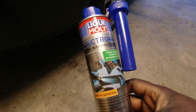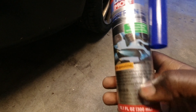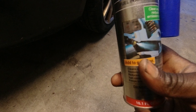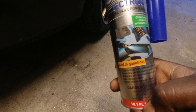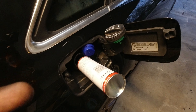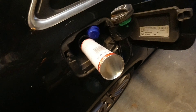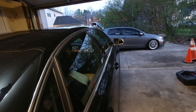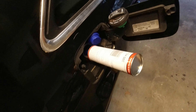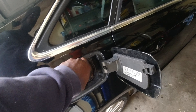The last thing is adding a fuel injector cleaner. This is highly recommended for anyone with a direct-injected engine because direct injection engines tend to produce a lot of carbon buildup. I like to add this every other oil change — it's a habit that's worked well for me, as I've done it with my Volkswagen too. And with that, we're pretty much done with all the preventive maintenance.